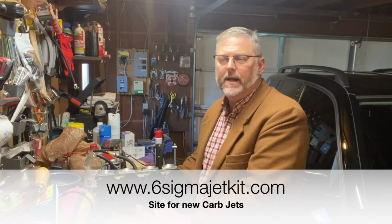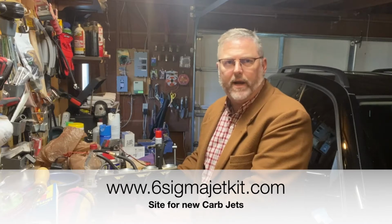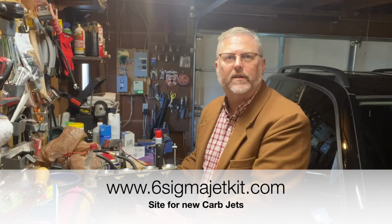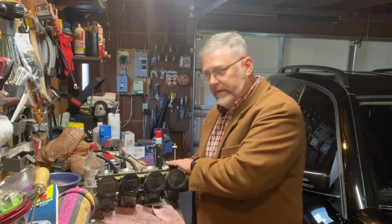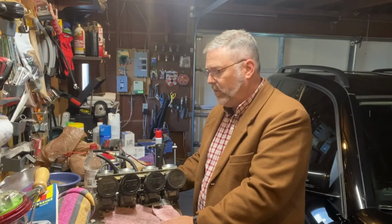You can give them the name, make and year of your motorcycle and what kind of modifications you have to it, whether you're using pod filters or have a custom exhaust on it, things like that. And they'll actually send you jets that you can put inside your carburetor to make them run for whatever application you've got. So I sent away for a specific kit for my Suzuki GSX1100, and they sent me the pilot jets and main jets that I needed to swap out inside these carburetors to make them work.